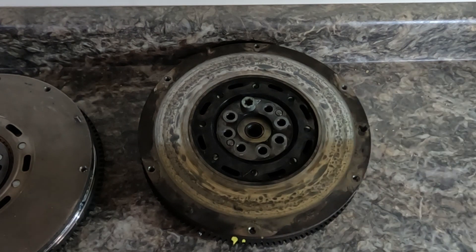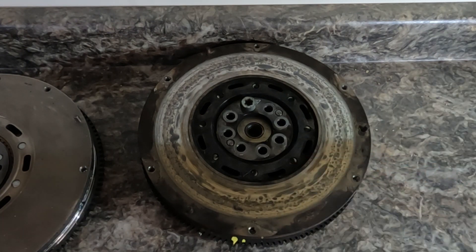This is an ex-flywheel. What I can do today is set the engine to top dead center, which means dropping the car down a little so I can get inside and pull out the cover. There is a teardrop-shaped hole in the front pulley where you put in — I think it's a 5/16th drill bit. Something also comes with the IMS installation kit, so I can get that set up and be ready to install the new bearing once it arrives.